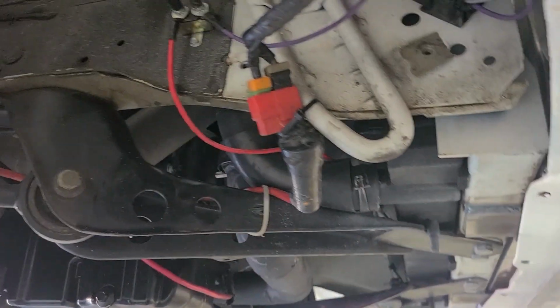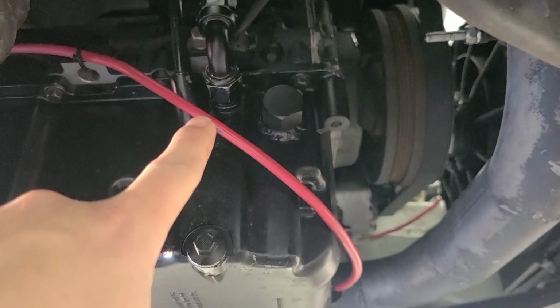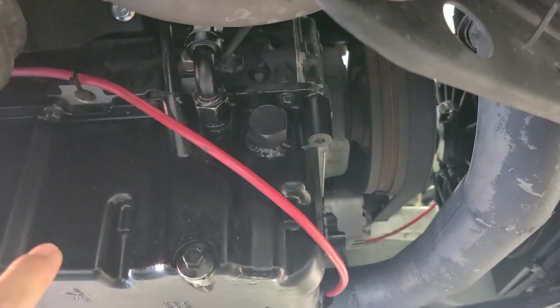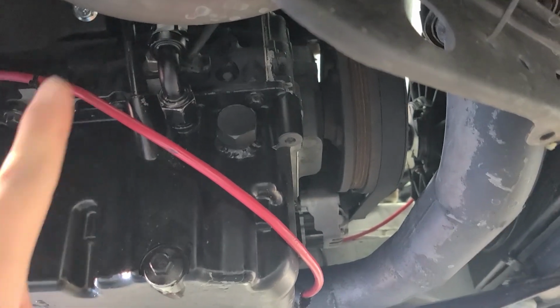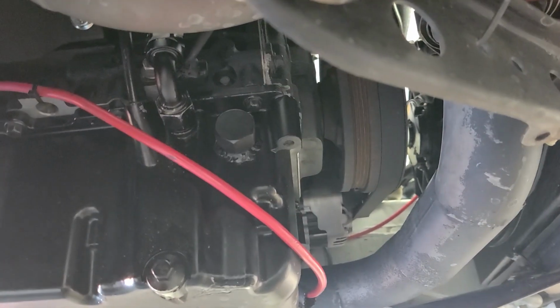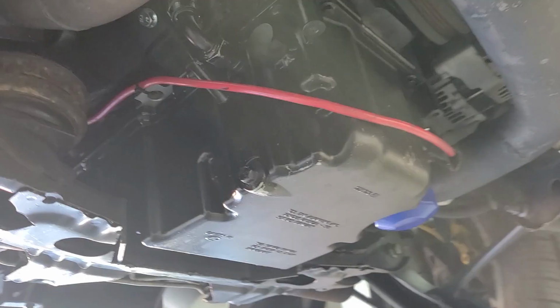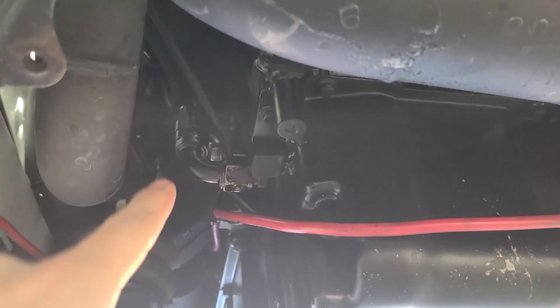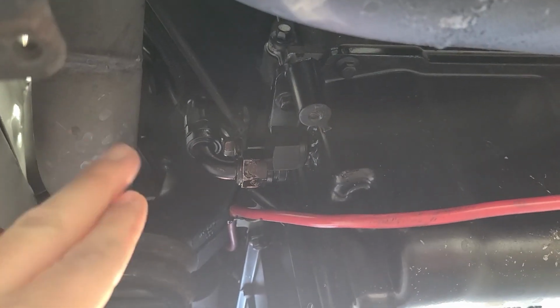I decided to take the oil line off and flip it upside down so that the fitting that was leaking on top would now be the fitting down here. That way I could verify for sure if it was the fitting or not. If the leak followed me down here, I would know the fitting was certainly bad. And if I had no leak up there, then I would know that fitting was certainly good. That didn't work because the fitting that was up there was a short radius 90, and the fitting down here was a slightly longer radius 90 by about 1/8 of an inch.